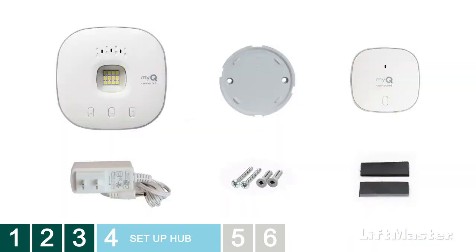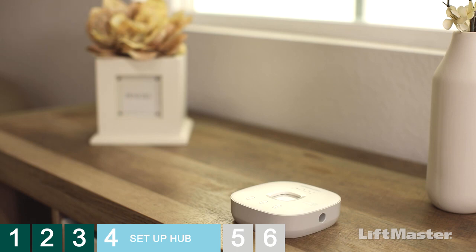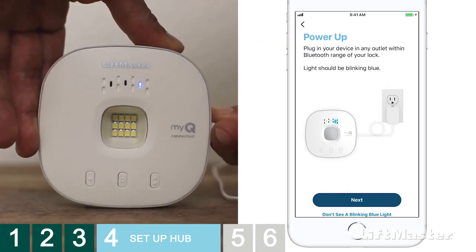What's in the box? A Wi-Fi hub, a mounting plate, a door sensor, a power cord, and mounting hardware and hook-and-loop strips. We'll only be setting up the Wi-Fi hub, so tuck the door sensor and the hook-and-loop strips away in a safe place in case you decide to set up a garage door opener later. In the MyQ app, tap Set Up New Hub. The checklist of things you'll need includes a strong Wi-Fi signal where you're going to mount the hub, the password for your Wi-Fi network, and Bluetooth enabled on your smartphone. Put a check mark by all items, tap I'm ready, and go ahead and plug in the hub. You'll see a blinking blue light. Tap Next.